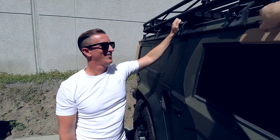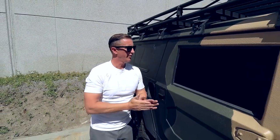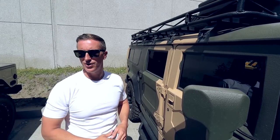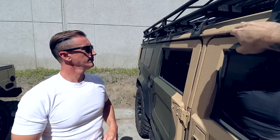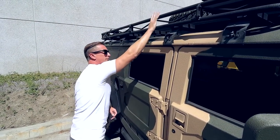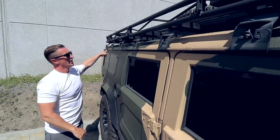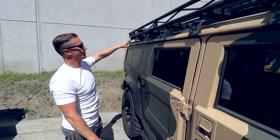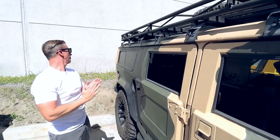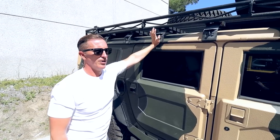This just looks scary — just imagine you put a heavy load on here, it's going to fold this thing down. We've seen that before. It's a cool design, it looks good, but there's better stuff out there. The integrity of the weight load would just be so limited with it being on this rain gutter. I do have to mention though, this is a pretty cool rack because it is aluminum, so it is a little bit lighter. I have seen some where there's like four mounts or three mounts across here — that's just not enough on these trucks. But it is probably one of the better basket-style roof racks if you have to go with the clamp mounts. I'll show you something better inside.